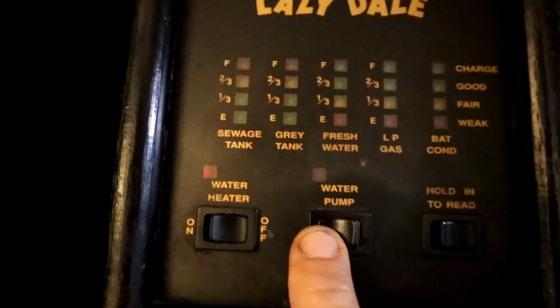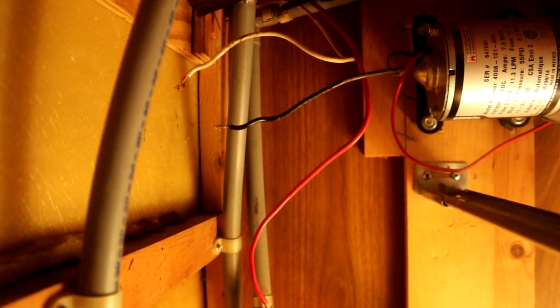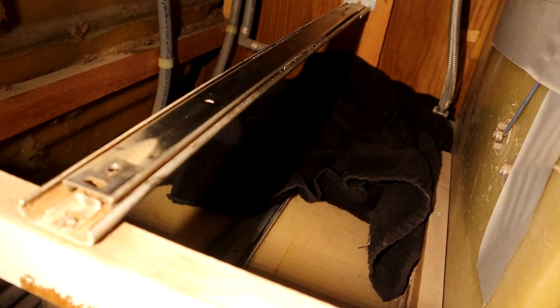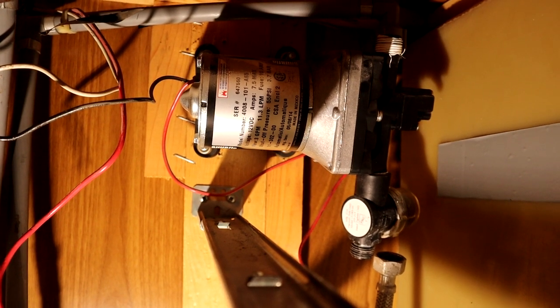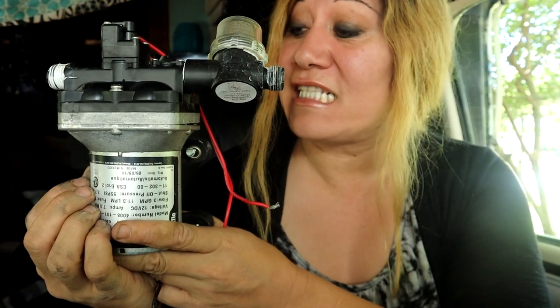Let me make sure — yep, no pump. Now that that's done, I can go ahead and disconnect the wires. I've already disconnected the wires. Normally I take a picture of how the wires went, but since I'm videoing I can always just go back and review. It was white to black and red to red. I've drained everything out, but since I'm dealing with water and I know there's probably still some water left in the pipes, I put a towel down just in case. I removed both pipes and fortunately didn't have to deal with any water — just a little drip from the pump. Now I just have to remove the four bolts and I can take the old pump off. And here is the old pump — it is fairly simple, easy peasy.